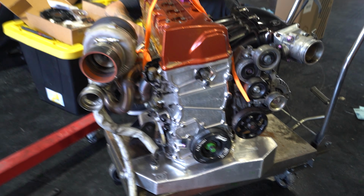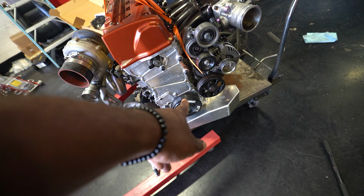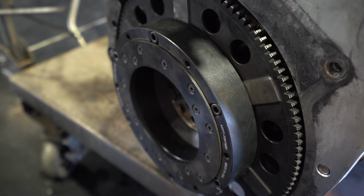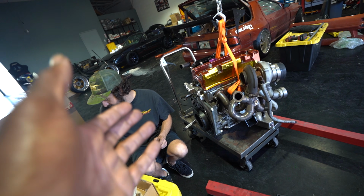But you know what else came from TF Works? Everything you see on this K motor. Beautiful billet intake manifold, that oil pan, this turbo manifold, and then we're still strapped up with the Garrett turbo, fluid damper pulley. Right now, Serge is throwing on the new TF Works twin disc. It's a K24 twin disc adapted to fit ZF transmissions.